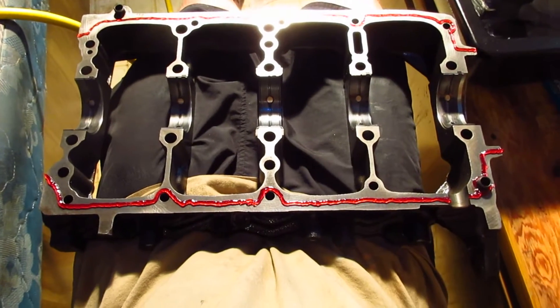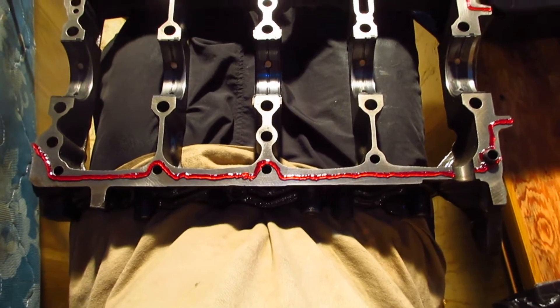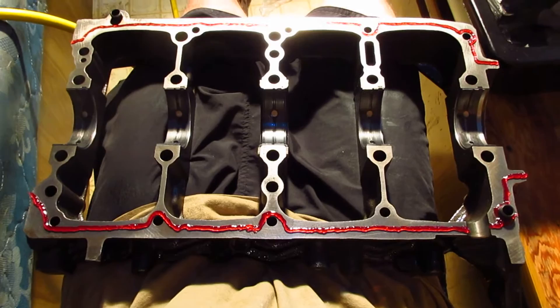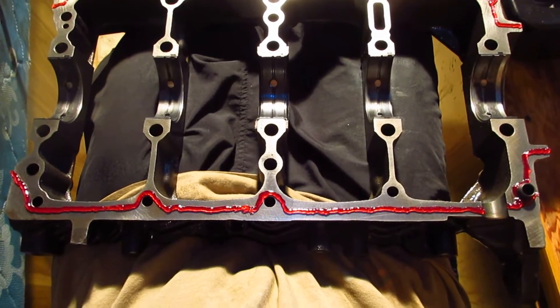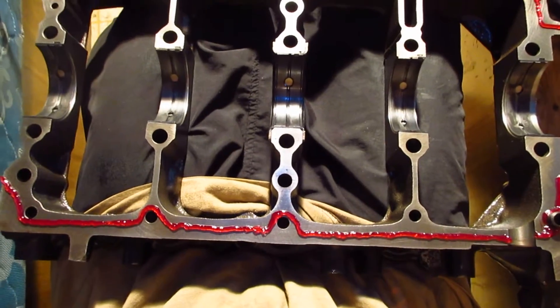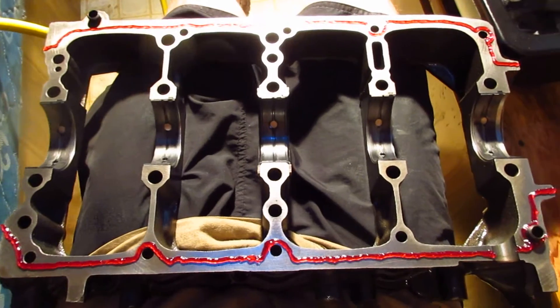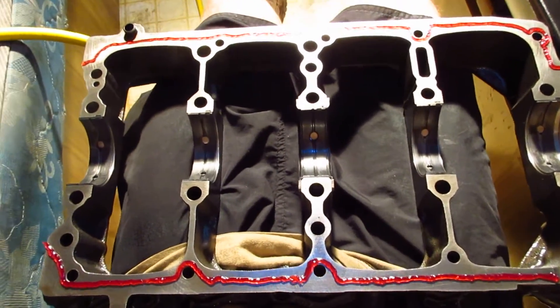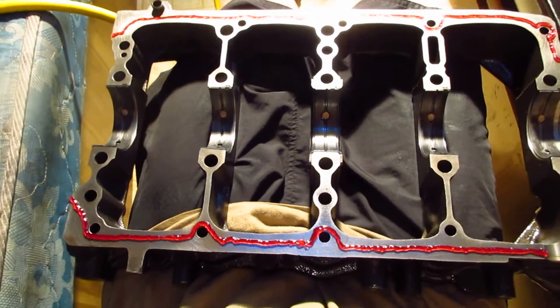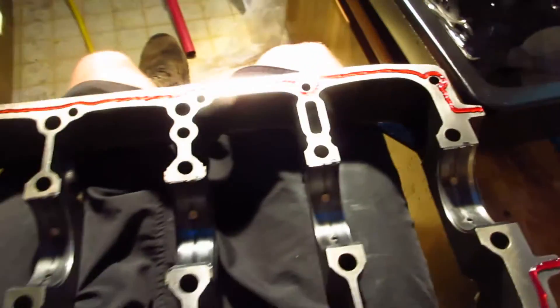Alright guys, I coated the bed plate with the sealant. I couldn't find the Mopar gasket maker or anaerobic sealant — it's a green color — but I got some at NAPA Auto Parts and it's been proven to work very well, as long as it seals the block from oil, as well as providing a very, very thin crushed thickness. I already sprayed off the block and the bed plate, so we're ready to put this on.